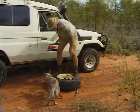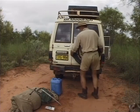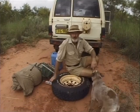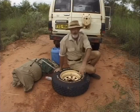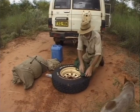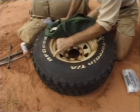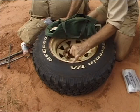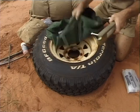With help from the dog of course. I've shown you lots of different ways that you can get your tyre off the rim if you don't have a bead breaker, but if you do a long trip you should carry one of these. This tyre's been stuck on the rim for a long time, so you've got dry mud and dust down between the tyre and the rim, and possibly even some rust, so it's going to be very hard to break that tyre from that rim. So what you need is a bead breaker.